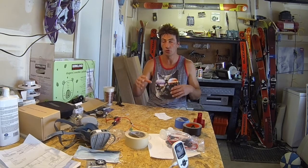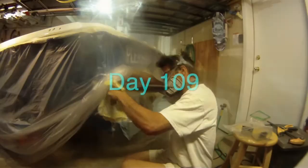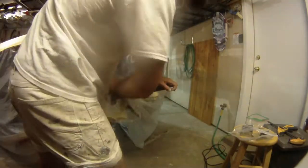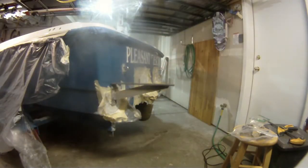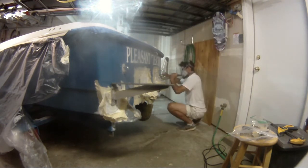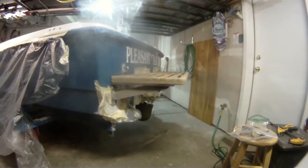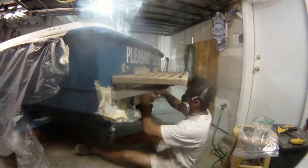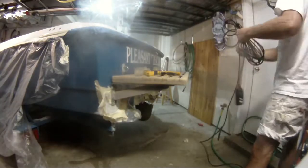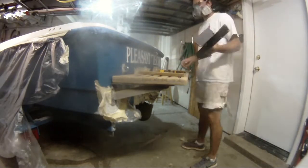In the first part of this video I am mounting the old swim brackets so I can get a look at the swim deck on the boat and start thinking about how I'm going to attach it with the removable brackets. I am mounting the original brackets with the top two bolts only — the third lower bolt holes have been filled in and fiberglassed over. The new swim deck brackets are the same geometry as the old outer brackets, but unfortunately as you move towards the center of the boat the curvature changes, blowing up all hopes of a clean swap over.